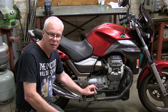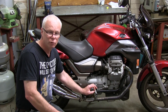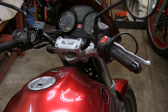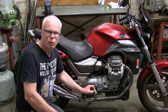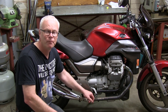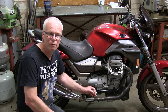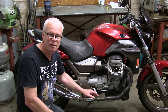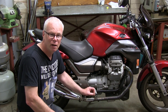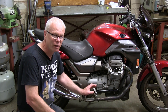The only other problems have been electrical. The fuel warning light, which indicates when the tank is low, has failed at the moment — I haven't got round to fixing that and will look at it next time I change the fuel filter. The other issue was the neutral switch: we're up to our third one. It's at the back of the gearbox just underneath the battery and requires a bit of contortion to get out. You can't easily remove the battery plate sitting on top of it, but you can slide it to one side and wangle it out. I've changed it myself once; it was changed twice by the dealer earlier in its life.